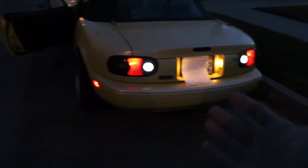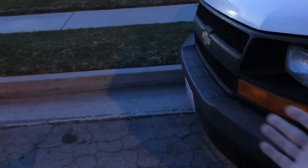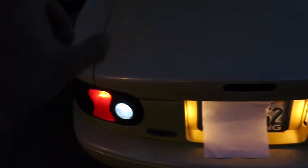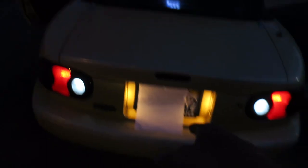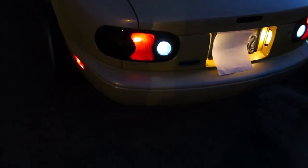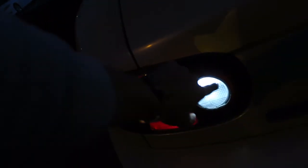The sun just went down. These are how the LEDs look. I'm gonna be honest with you — they ain't that bright. They're not shining like I expected. I'm gonna see how close I need to bring the car for you to see it on the bumper. For sure they look pretty cool though — a nice white. Pro tip: if you've got one light on and one off, or it didn't work, do the process again but flip the bulb 180 degrees — flip the notch to the other side and put it back in, and that's gonna work. There's no way of seeing from outside the bulb if you've got it on right, so just rotate it if it didn't work. 6000 Kelvins my ass. To be fair, the Miata stock lights are pretty fogged up, but I'd still like to see it shine on the bumper.